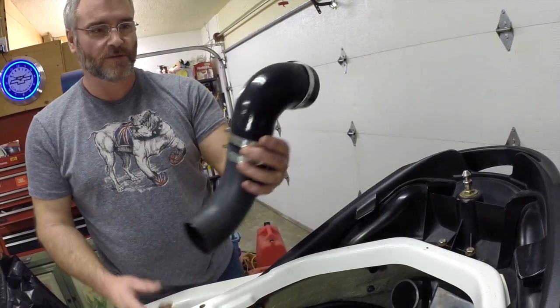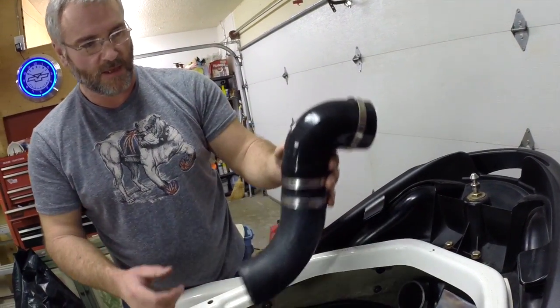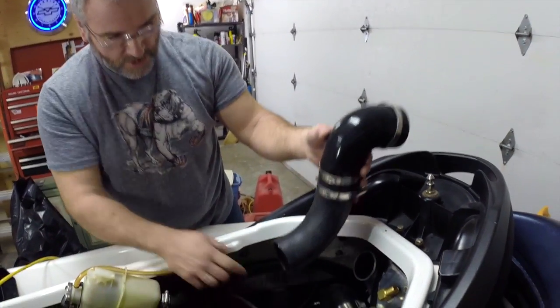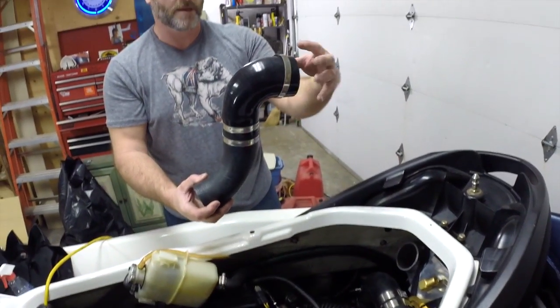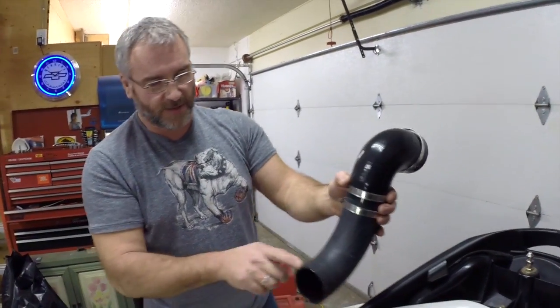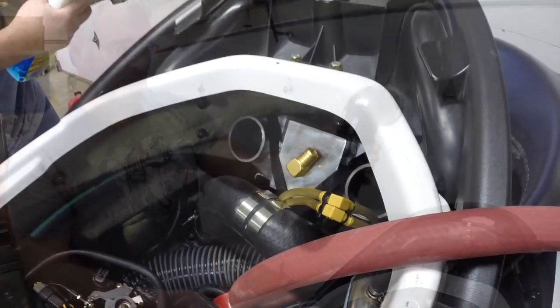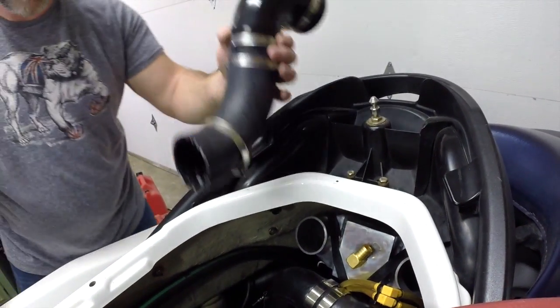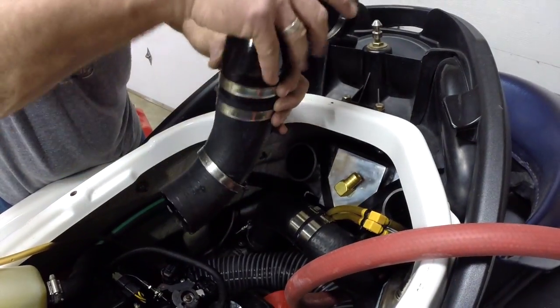This is our supercharger outlet — it's going out of the intercooler into the throttle body. I've made this up: it's a 3-inch 2.5-90, and then this is just roughly a 60-degree section of old exhaust hose. A little Windex just helps to slide everything together.